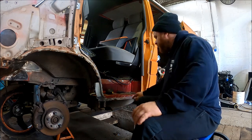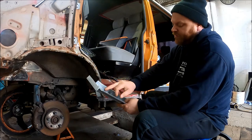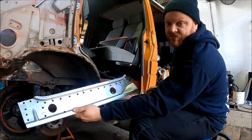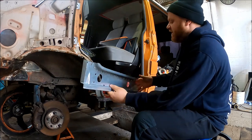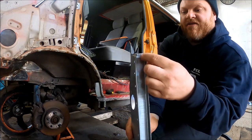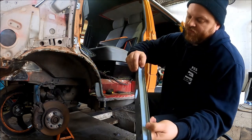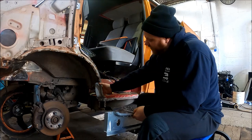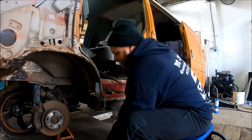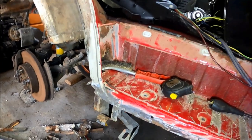What I've done is run the disc cutter and sliced out the bottom of the lip. This is my new inner seal here with the plug welds — you can see where I've drilled the plug weld holes, and then around where it would attach the outrigger. I've joggled the end there so that lip will sit inside, and then I've drilled the spot welds off here.